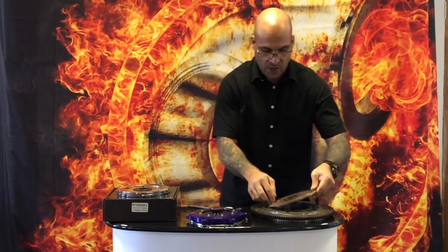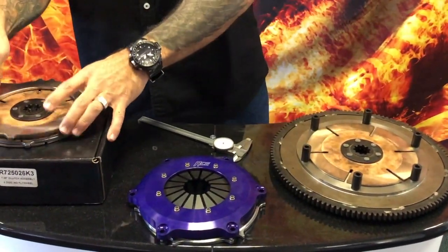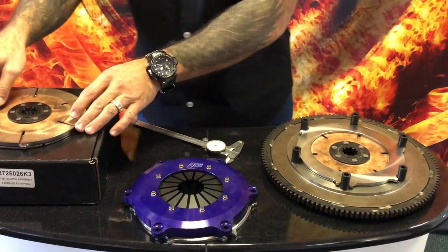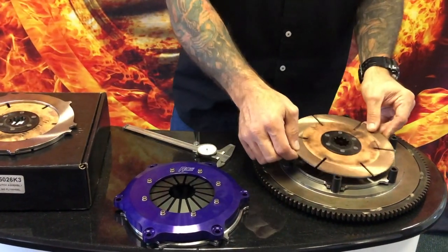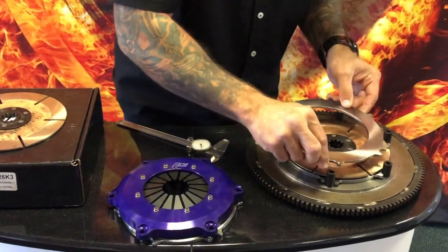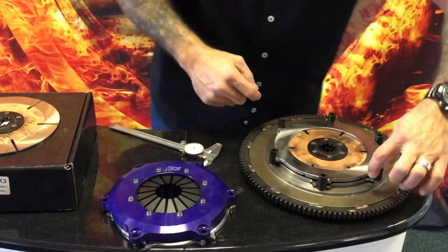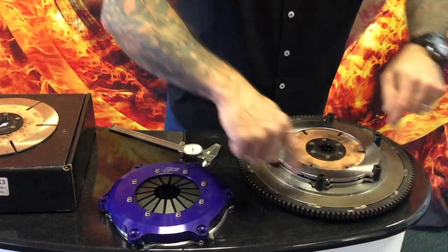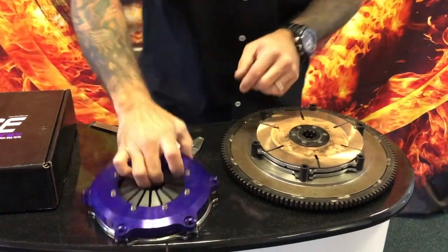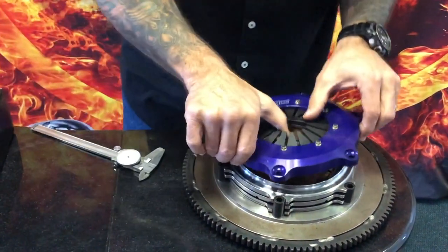So that's essentially how it goes — I'll show you how it assembles. Your first friction plate will go down onto the flywheel, then you have a friction face which comes from ACE. In this case it's a triple plate, so you will have your second plate, your second friction face — which we like to keep off center. You've got a double hook there, double hook there, and then what you'll do is offset them. So at every point you've got two hook-in points. Then the third plate, intermediate ring, and obviously your pressure plate.